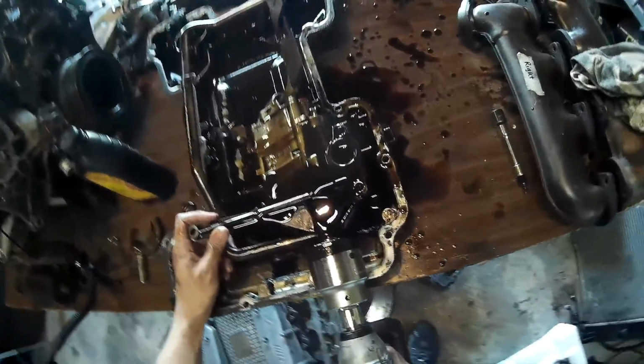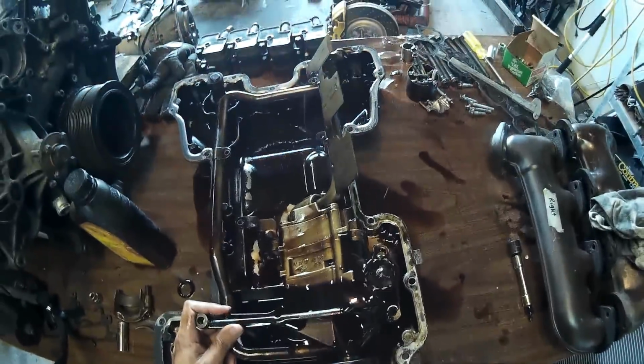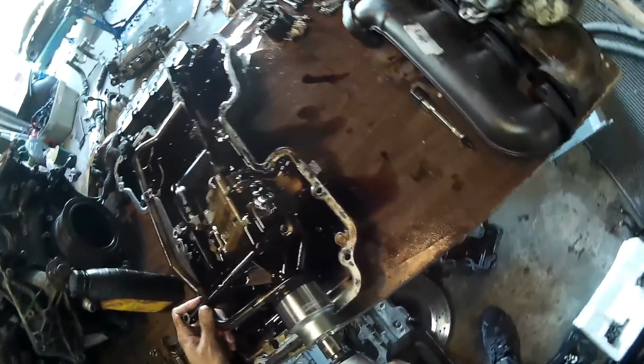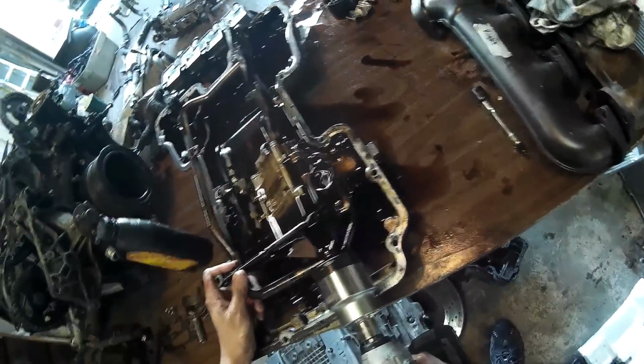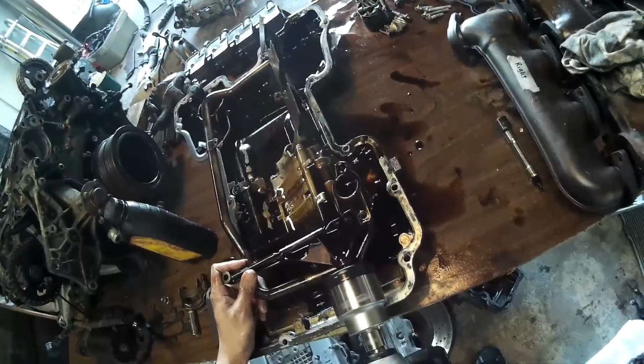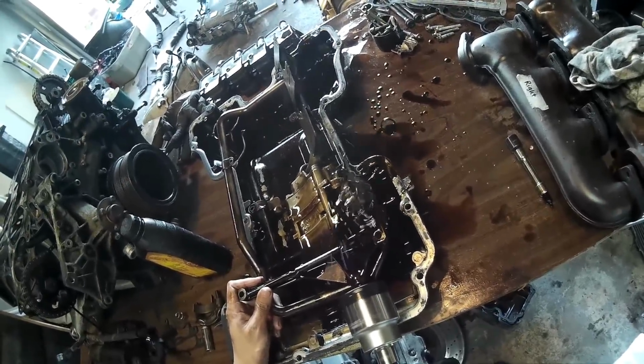So for everyone that's saying the engine didn't blow because of a broken O-ring, that's pretty much like saying the engine will run without oil pressure. No engine will run without oil pressure. Any engine will basically destroy itself in a matter of a few minutes if it loses oil pressure. And with this O-ring you can clearly see that there's no flow going to the engine at all. So like I said in the previous video, that's obviously what blew the engine.